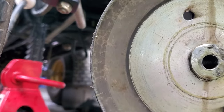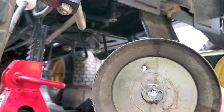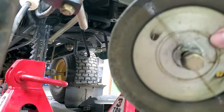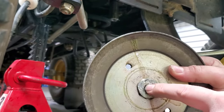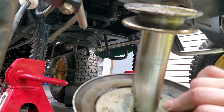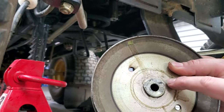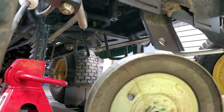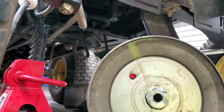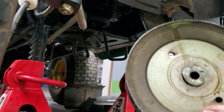You'll notice I did stay around the outside. There were a few times I kind of nicked the middle a little bit, but if you nick that too much you will have issues getting the bolt back in — you might have to bring that brass back out a little bit. If you mess it up you can use a drill bit or whatever; it's not a hugely sensitive piece, but just pay good attention and try to stay around the outside of this washer. If you're using a hammer, you can use a small ball peen hammer and hit it with a larger hammer — that'll help keep the metal from getting any damage.